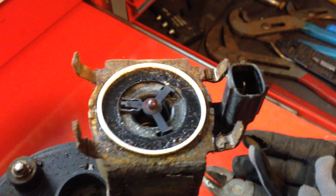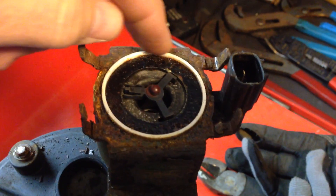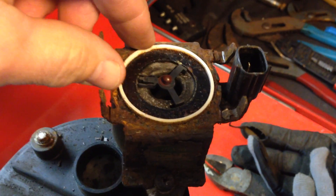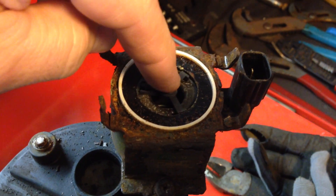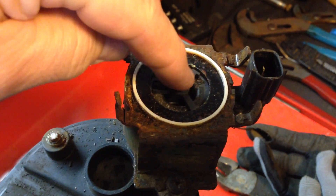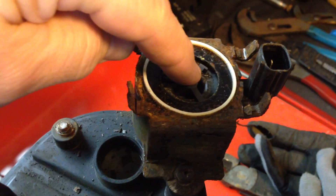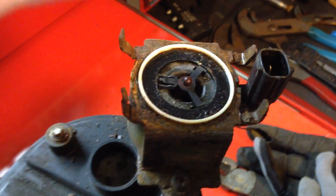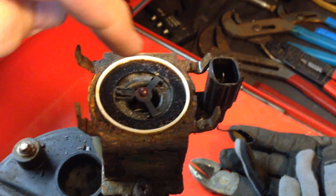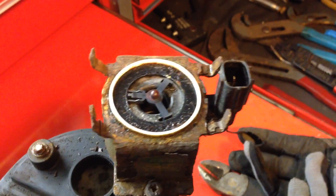What happens is either this o-ring here can start leaking to the atmosphere, or this diaphragm won't shut all the way. You can actually get spider webs in here, and you can also get moisture in here. If there's a slight leak in here, that can kick the check engine light on, and if the solenoid stops working, that's when it really kicks the code.